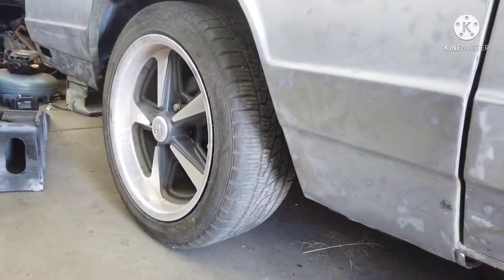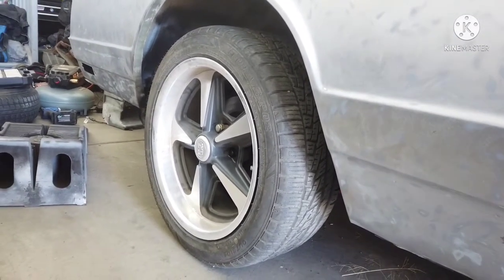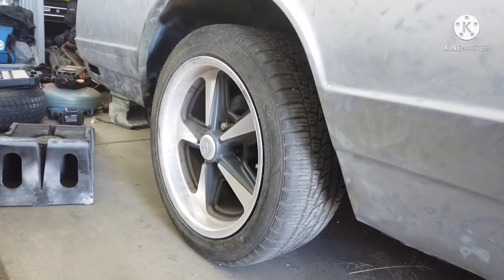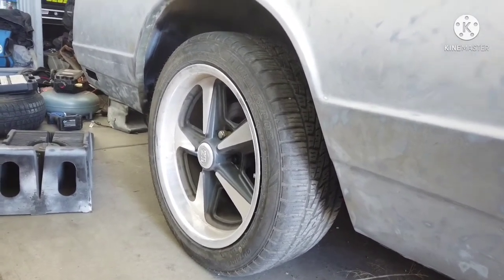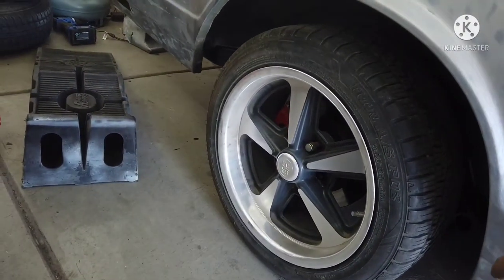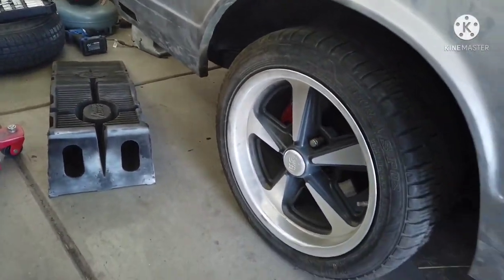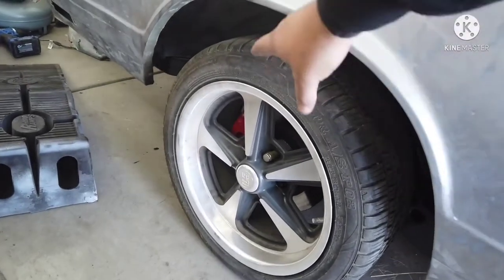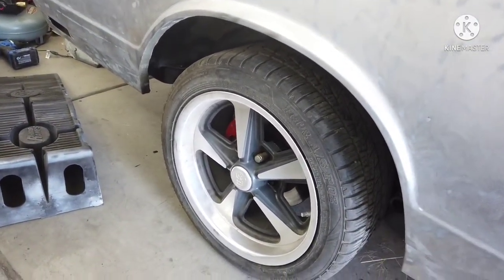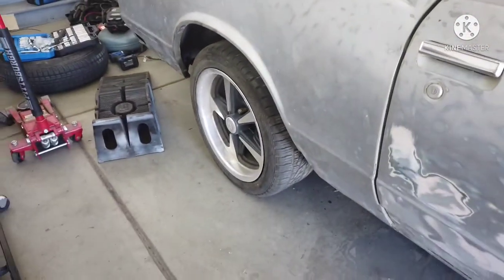So there we have it — she's on the Elco wheels for now. I just checked the backspacing and I still have about an inch and a half behind on each side, so I could go with the 20s I was looking at. With the 5 inch backspacing and the room I have, I think I need to go a little bigger than 17s, definitely bigger than 18s. I think the 20s will fit real nice — maybe even some 22s, but that really takes some measurements.